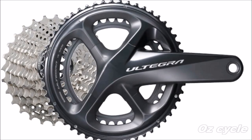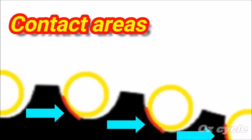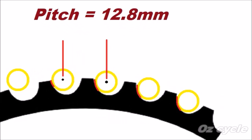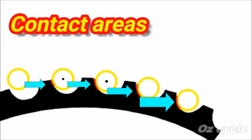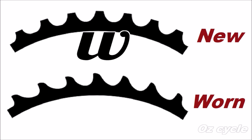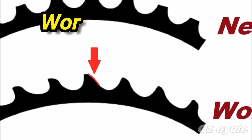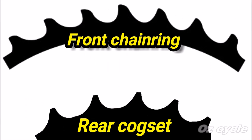Now let's have a look at how a worn chain will affect your front chainring. The rollers sit low in the valley between each tooth. The chainring is moving and pulling on the chain, so the rollers exert their force on the front or leading edges of the teeth. With a nice new chain at 12.7mm pitch, everything's fine. At 12.8mm, the rollers begin to ride up the side of the teeth, the contact areas decrease, and this begins to compound the wear. So the new chainring teeth look a bit like the letter W, while the worn chainring has sharp teeth, a bit like a shark. For the chainring, it's the right side or leading edge that gets worn, while the left side stays intact — the opposite to your rear cog set.